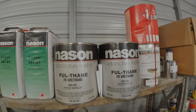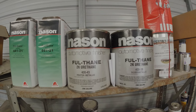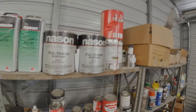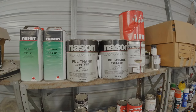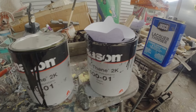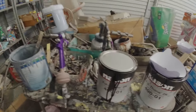I haven't opened them yet - I'll open them up before I'm ready to paint and make sure it's the right color in the can. I bought a can of red before, opened it up, and it was pewter. Here's the reducer and the hardener. It's a great paint, it'll last forever. It's a single stage urethane and I'd rather paint with this than base clear any day. Here's the black mixed up - a quart to paint stripes.